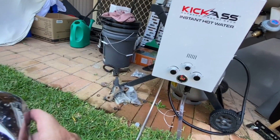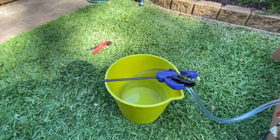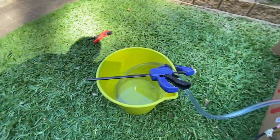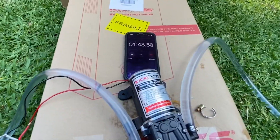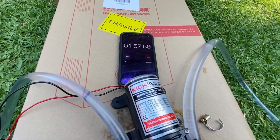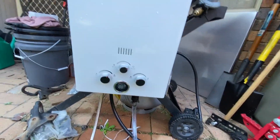We turned it up to max power by hitting the max button, and then the temperature drops as the pump works harder. The tank is almost empty at 1 minute 25 seconds. It obviously drains a lot faster on max, and we're almost out of water at close to two minutes. Stopped at two minutes — virtually empty — and the system turns itself off.